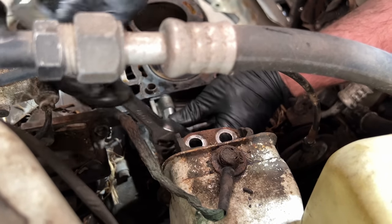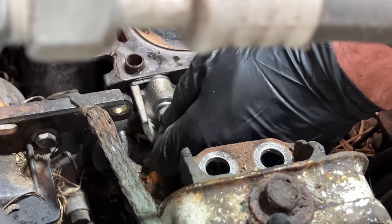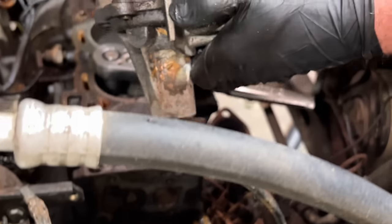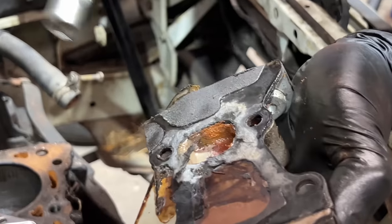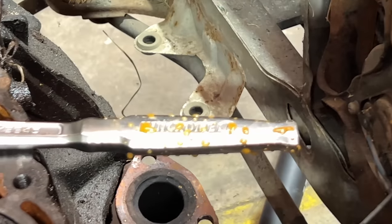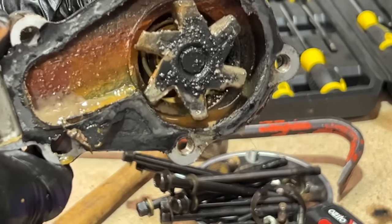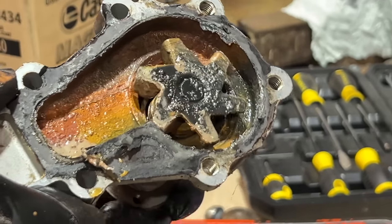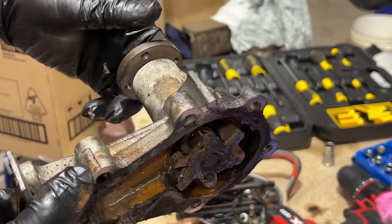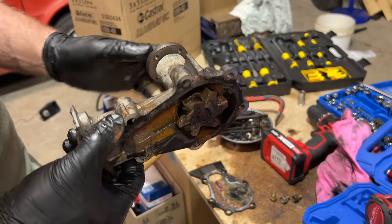James reckons there's going to be no fans left on the impeller. This looks replaced — look at the colour versus the block, that's been changed. Still got a plate on the back so we can't see. There's grey sludge in there. We've got to get that plate off. They've still got the impellers — okay, we could reuse this. You need to feel if there's resistance on the seal; if it just spins it's going to leak. But there's a rubber seal in there and you can't just spin it, so it's good, it's fine.